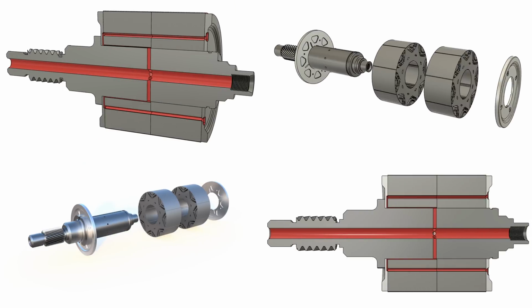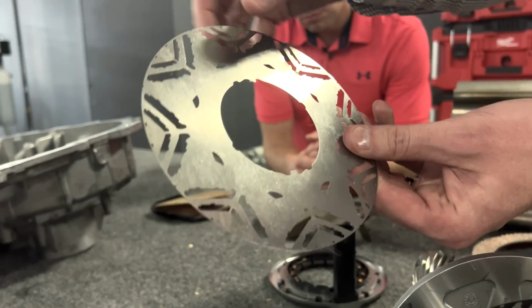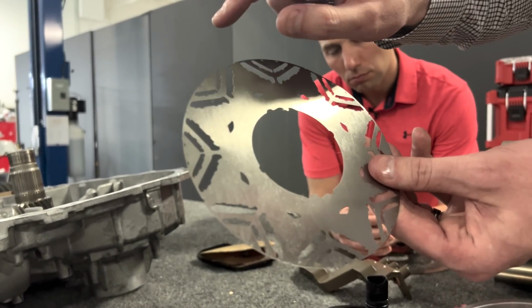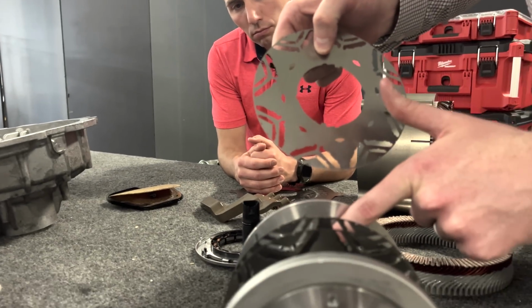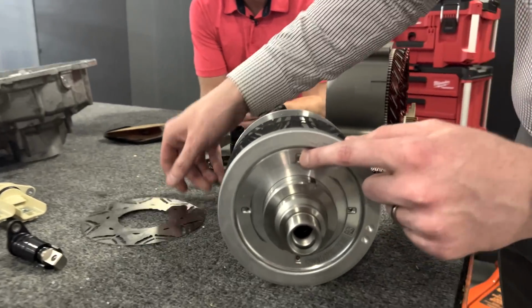But from the video perspective, all of these spacers, typically they're cut out, they're not really needed as far as the rotor assembly or any magnetic fields, but oftentimes people will run oil through these to cool the rotor, or the stator. But this is running across the shaft itself, up through here, and then back across the entire stator assembly, and then it exits out this pathway here.